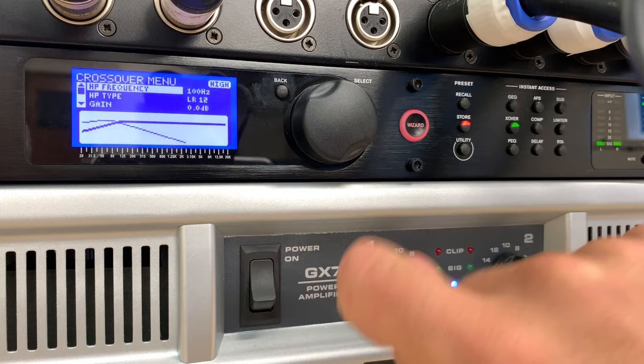Having the bins go up to 125 Hz, you might set the tops exactly the same, or drop it a little if the crossover point sounds weak — you might want to overlap the crossover points a bit. I'm going to set it back down to about 120 Hz. We can also play around with the slope — you can hear the sound changing as we change it. I'll go for 24 dB there. I also have the option to boost the volume, just to demonstrate — it gets louder. Then turn it back down.